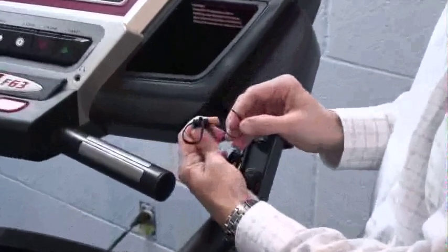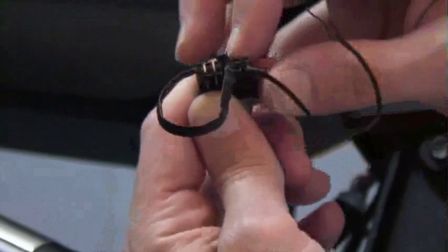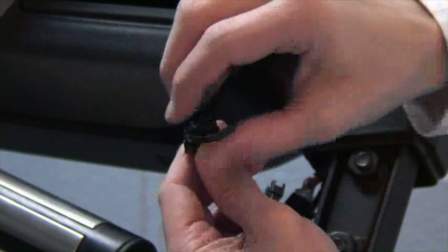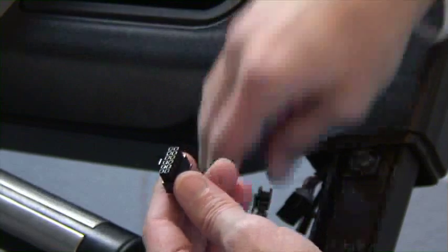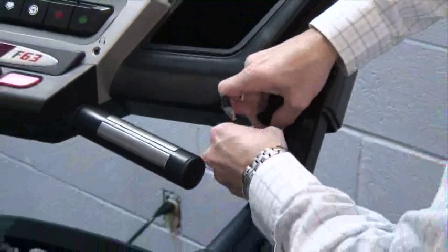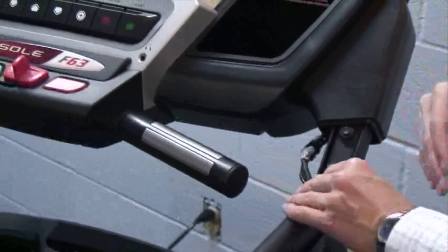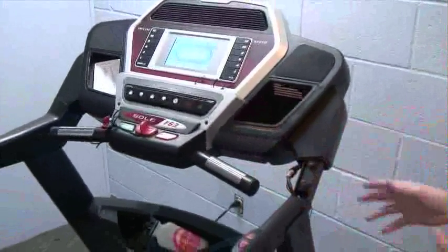And that's it: 1 and 4 to activate, 7 and 5 will speed up, and 7 and 6 will slow the belt down. Pull them out one twist tie at a time, hook the harnesses back up. We've done no damage, the display is lit back up, and at that point we have a good diagnosis as to what is going on with the equipment.